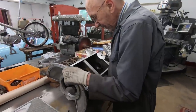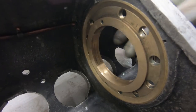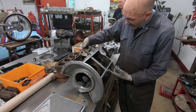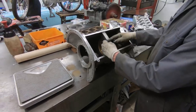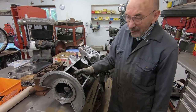These engines have a centre main, and very often this bit fits loosely in there. People do all sorts of funny things - they drill a hole through here and a hole through there, put a piece of rod in with two little screws, cut that and squeeze that lot together. Well, once that's done, it ain't very good.